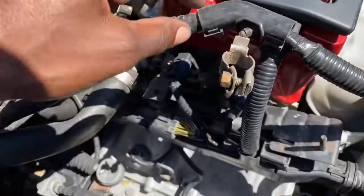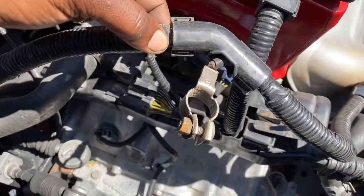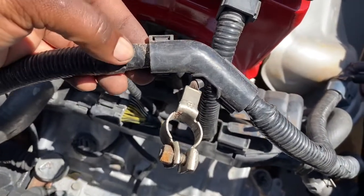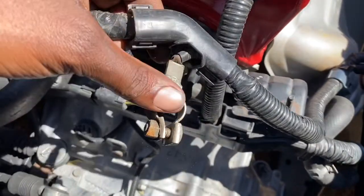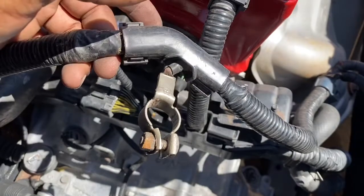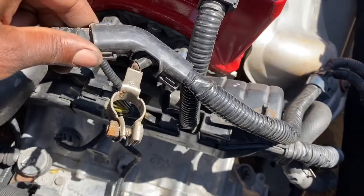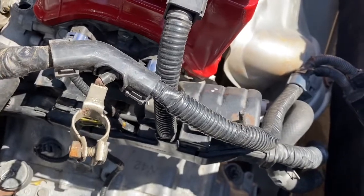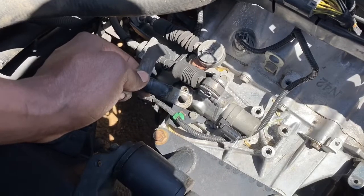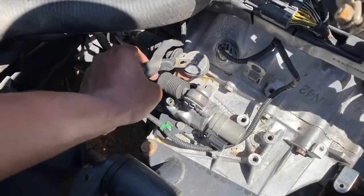The wire is gonna come from this charge harness. I like to just cut it from right here since it's a little bit too long. The charge wire is usually white or completely black, but the one that's the starter is gonna have a yellow stripe on it. The other starter wire is gonna go to this right here, which is directly off the starter from the MR2 swap — just connect those and your starter will have its straight power.